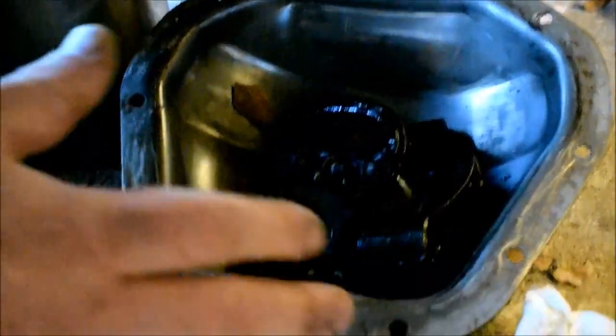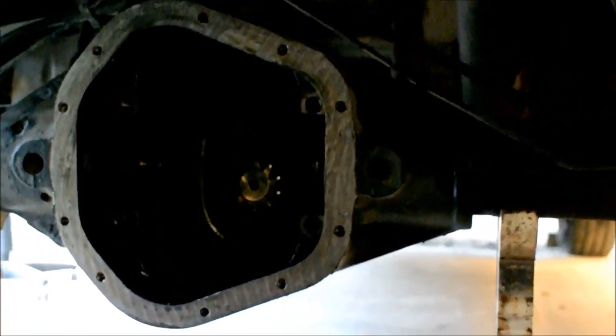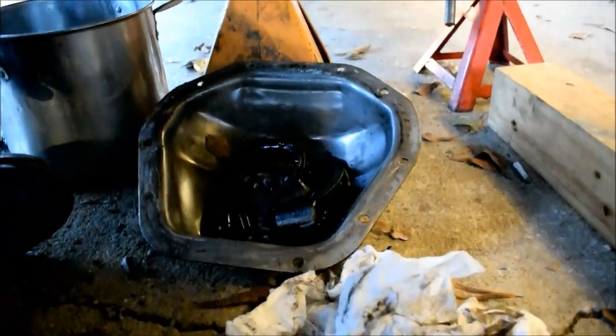That's about cleaning up. You would use RTV black on this because it would resist the most oil, and you don't need a gasket, because it didn't come with a gasket on it, and so on and so forth. We've almost never used a gasket on our rear end housing covers. Pause that for a minute.